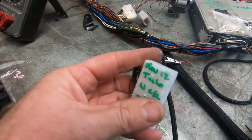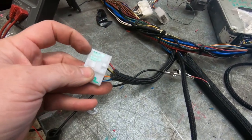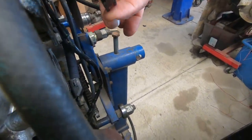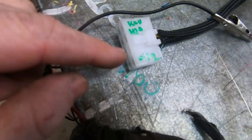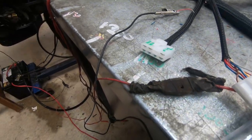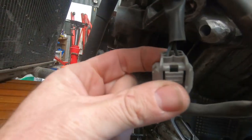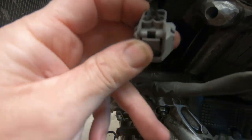And there's this little extra connector. In here there is a reverse light 12 volt input and a reverse lights out, because he asked for me to put a reverse light plug in it. So we can build a little gearbox loom for that. There's a water temp. There's two oil lights. The front loom didn't come down with it, so he'll just whip this plug off, extend the wires down to the oil pressure, and whichever one he chooses, either the blue, yellow, or the black, that becomes the oil light.